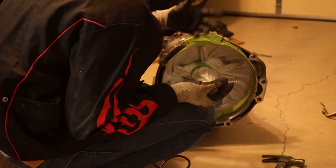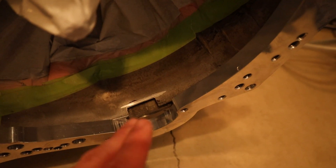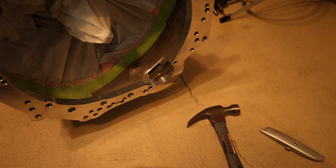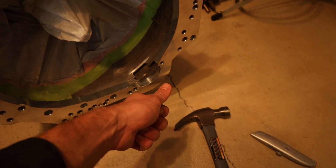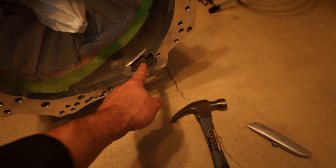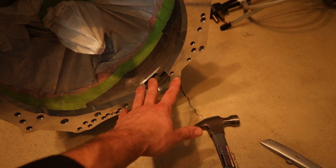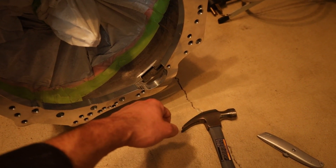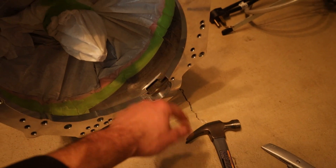Here is the cut that I've made. I really don't know if it's going to be deep enough or wide enough. I've put the adapter back on here just for reference. I may mess around with placing a little spacer to account for the engine block and then see if the starter motor will fit into that gap. There's about a 50/50 chance that I need to widen this out and make it just a hair deeper. I'll get back with you.